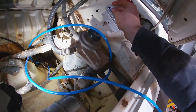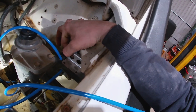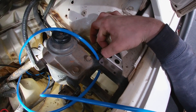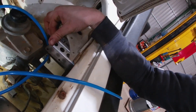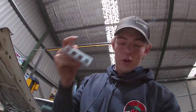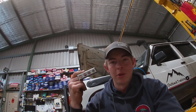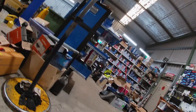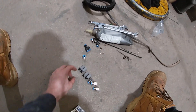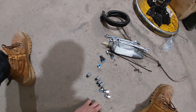I've looked around for a couple of places to mount it and I think I'm going to put it in here because I only really want to use three ports - the transfer and gearbox share one line. Mounting it here gives me access to three ports; I could use the fourth but there's no real necessity. Before I put it in such a tight spot I need to install the little fittings into the station first, so I'll thread through the fittings and the diff breather caps and show you what that looks like.